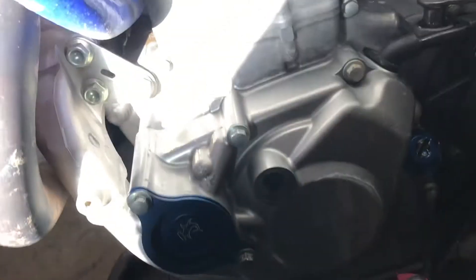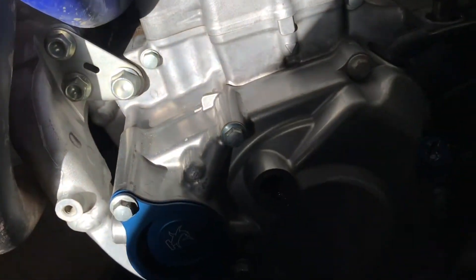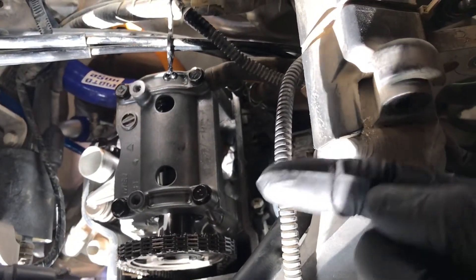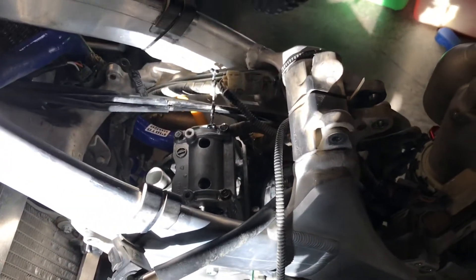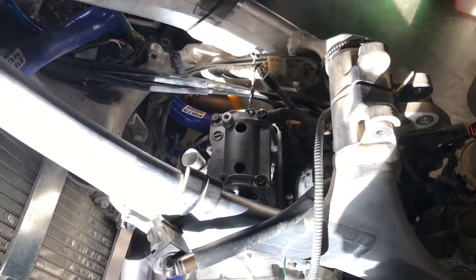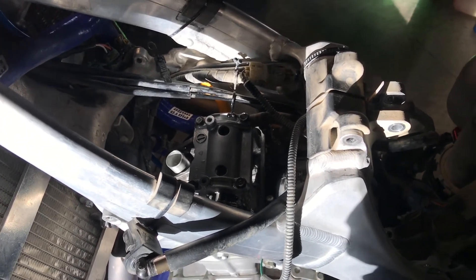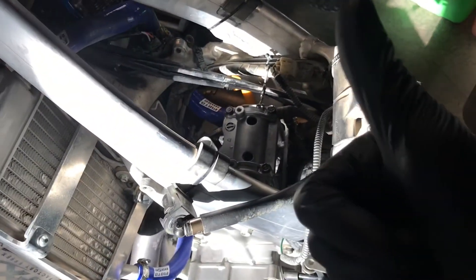Always remember to re-verify timing multiple times, and don't forget that final engine rotation at the very end. I did take the bike apart a little more than strictly necessary — just to access the intake valves easier. It's slightly different for other brands; Yamaha's is different, and on the five-valve engine you'll need a slimmer feeler gauge for the center valve. But they're all basically the same — just make sure you get within spec, which we did. Good job shimming your valves.